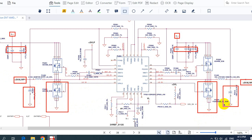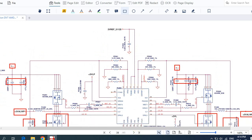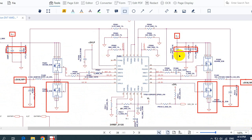you can sometimes see signs of life in the laptop — for example, flashing LEDs, or one or two LEDs turning on. But if the problem is in the first circuit with the charge IC, the laptop will be completely dead. In the 3V/5V circuit, you should check the capacitors and also check the IC, because every IC on a laptop motherboard should never be shorted to ground.